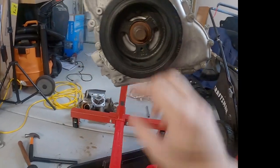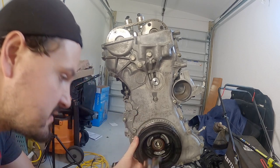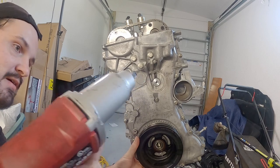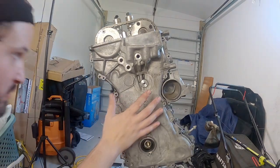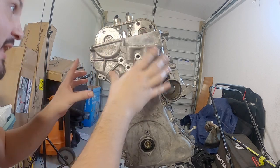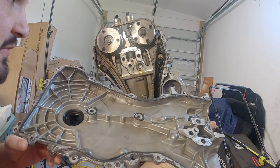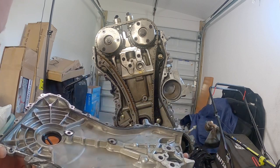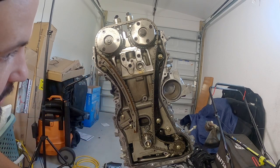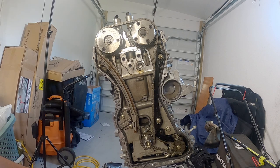I need to get this timing cover off, and to do that we had to remove our crank pulley. You would not believe how much time I spent trying to pull this damn crank bolt off — it was stuck on there, giving my Harbor Freight electric impact a real workout, but it got it off. I just spent like an hour alone trying to remove the timing chain cover and I finally got it loose. Not only do you have all those bolts, but you have silicone everywhere. There's no gasket for this — it's all silicone. I took a box cutter and was going in between and slicing the silicone. It was the only way I could get it out.